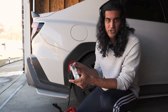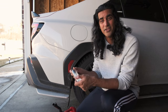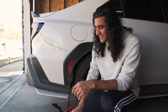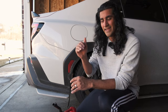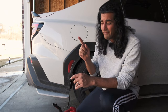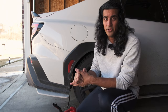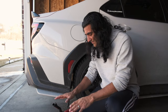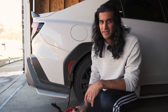With the blend tune, I'm going to splice into this video a clip showing you which websites I use to calculate my blends, so if you're looking for E30, E40, or E50, there's a good resource for that. There are a couple of tricks to remember: once the gas indicator hits the triple dashes, you're pretty much out of gas, but I've calculated you have somewhere between 1.5 and 2 gallons still in reserve. When you're doing your ethanol blends, make sure to take that leftover gas into account.